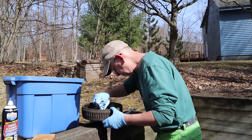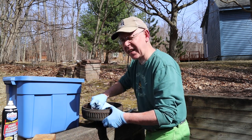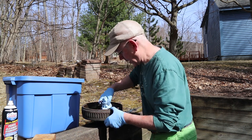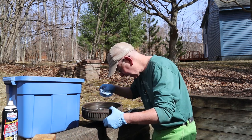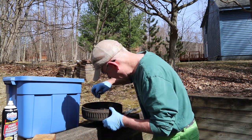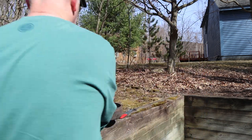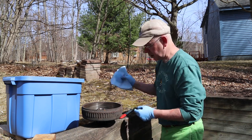Now, you don't have to do this for some trailers, right? Yeah, all the new ones should have lube-free bearings. Something to check. Yes, so only if you have the older trailers do you have to do this. Your manual should let you know. You want to make sure there's nothing in there that could score. Make sure it's super clean. No dirt. As we were fond of saying at work, lube it or lose it.